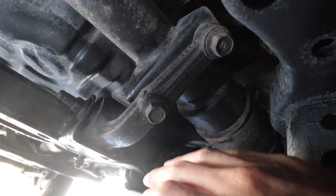All right guys, so some more LC maintenance going on — we're going to be changing out the front differential bushings. After greasing the drive shaft, I still notice going from reverse to drive and so forth there's a bit of a clunk or a thud going on. So I looked into what could possibly be the next cause and people are saying it's these bushings.